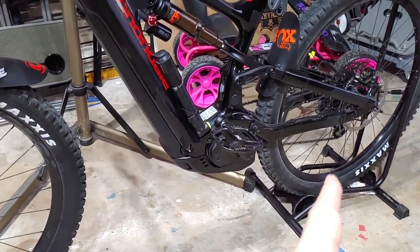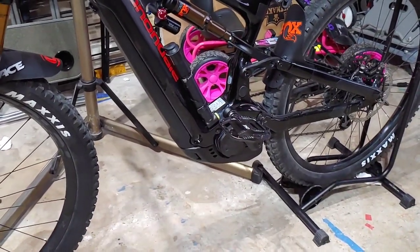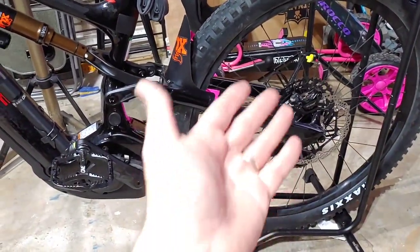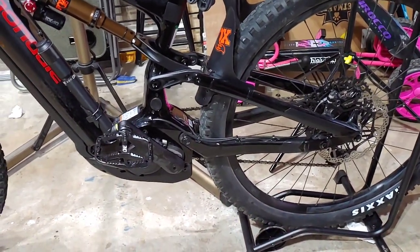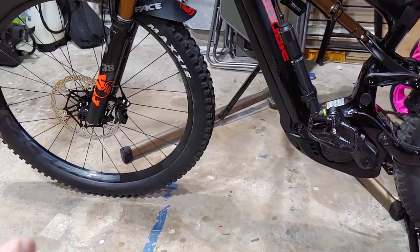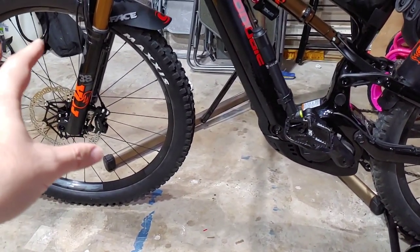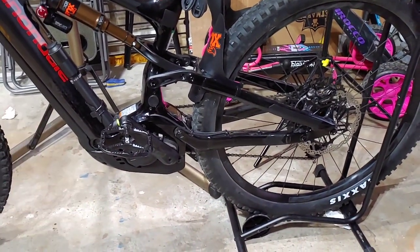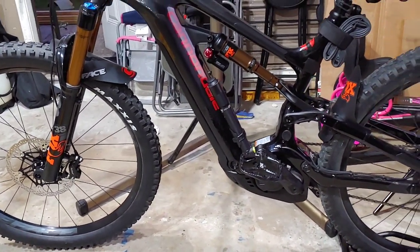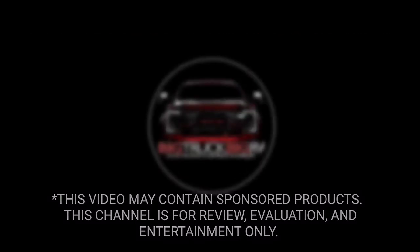The back is a 200 millimeter rotor and it was making very little contact — not enough to stop the wheel aggressively when spinning, but definitely enough to rub, and I had to shave that down a little bit. If I ever see anything significant in terms of wearing or that potentially breaking, I'll just throw a different set of calipers on. On this setup: the front is a pure drop-in, the back needs about five minutes of grinding and you're in good shape. I hope you enjoyed this video — please subscribe to my channel, give me a thumbs up, and we'll talk to you again very soon.